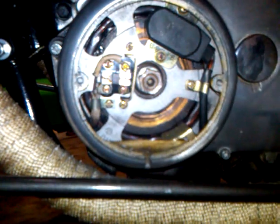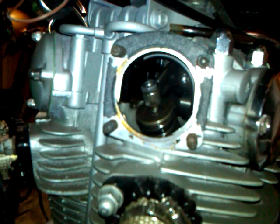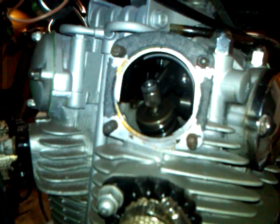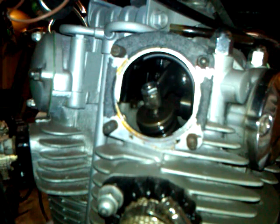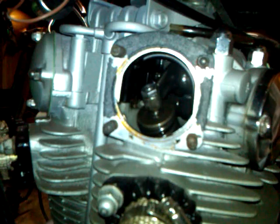I'm going to turn the rotor counterclockwise only and see what's going on — see which valve is moving. If you're on the compression stroke, when you start turning the rotor, the piston goes down and comes back up, so the exhaust valve should start opening. There's the exhaust valve opening — that means you're in stroke four. The piston is going up, pushing out all the exhaust. Now it has gone through its full rotation and is closed again.